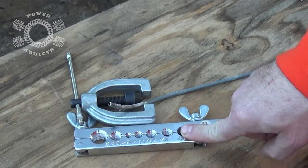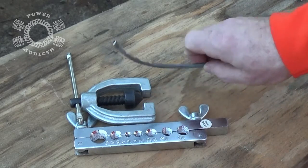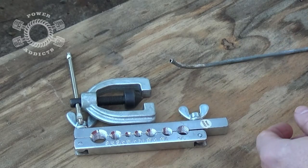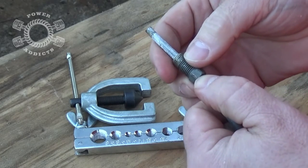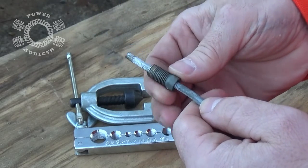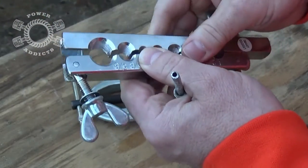Here's the tool just about everybody uses — you can go to your auto parts store, Harbor Freight, whatever, and buy this tool. To be 100% transparent, over yonder are the dies to do the double flare. Most people end up thinking it's okay to just put one flare in it. No, it ain't. Take your little fitting, slide it on — you always want to put the fitting on first. I've flared a line before and then realized oh crap, I forgot to put the fitting on, so that's a bad thing.